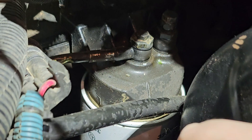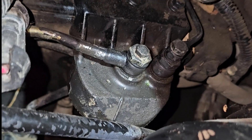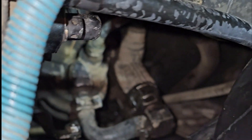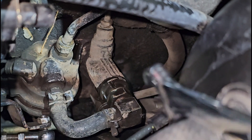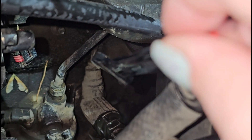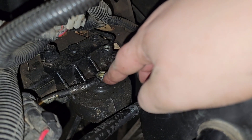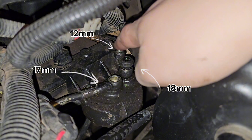I'm going to take the fuel filter next. So the fuel filter was there and the lift pump is down there. This hose needs to come off. Then you'll loosen up this fitting up there. On top of the fuel filter, you'll want to remove this just so that you can get on top of this one — you've got to remove that one.